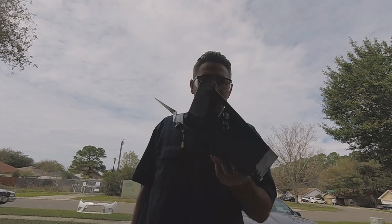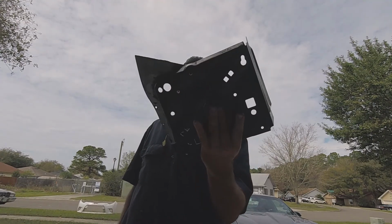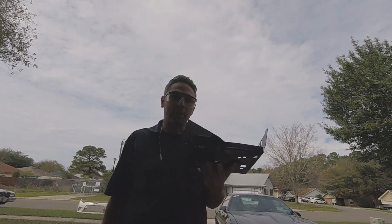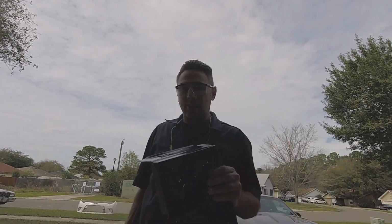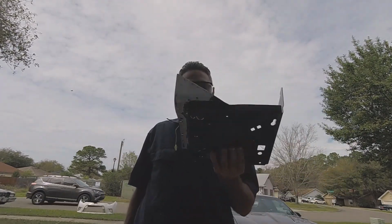So you'll notice that I've already started grinding this down because I'm obviously going to prime this with some weld through primer. I'm not going to touch the bottom because, as you've seen, there's a giant hole to the ground. So once this is all welded in and cooled off, I can climb underneath there, scuff this, and paint this, which is what I'm going to do. But I won't be able to paint anything underneath here for that matter.